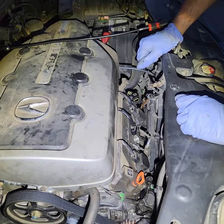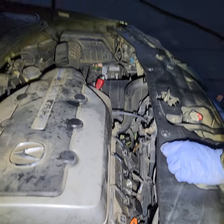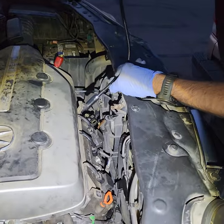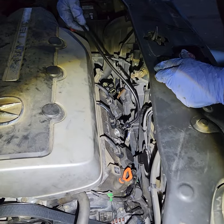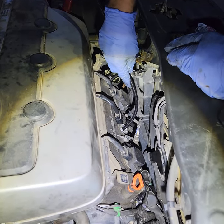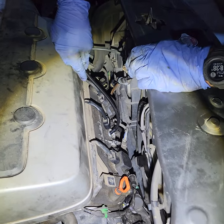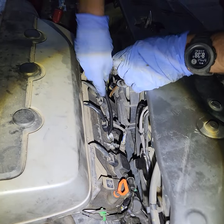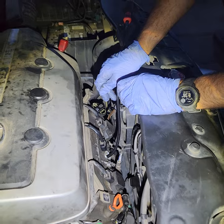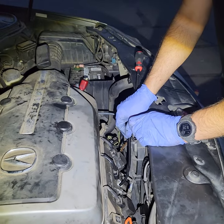You're wondering who has just a magnetic 5/8ths socket? If you're a real mechanic you have one of these with a light. You angle it in and slide it in — this is a magnetic straw. After you make sure it is clear, you pull it and slide it out, angling upward so you have enough space for the spark plug to get out. Don't forget to use spark plug grease when you put everything back on. Just do everything in reverse and I think you guys are capable of doing this. Thank you.